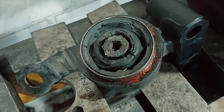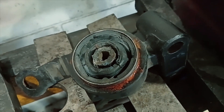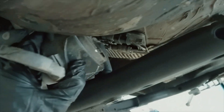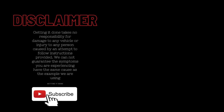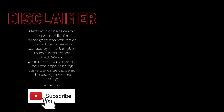That arm is now ready to go back in — it's just reassembly from that point. We're going to do the other side first, but that is how you replace front lower control arm rear bushes on a Mini Cooper S — this is an R50. I hope that has helped you out today. Don't forget to click like and subscribe for more real tips from real mechanics.